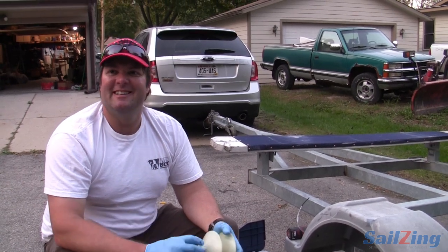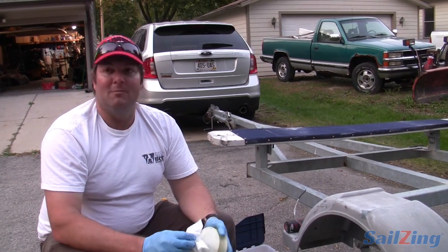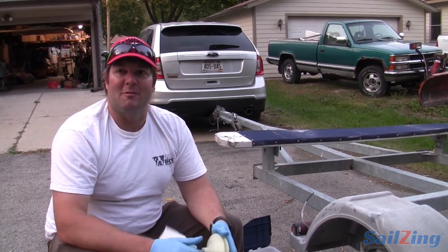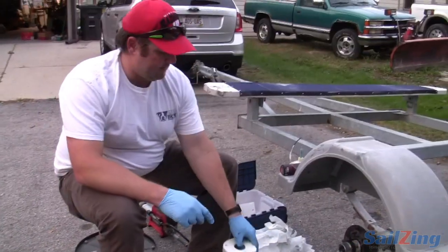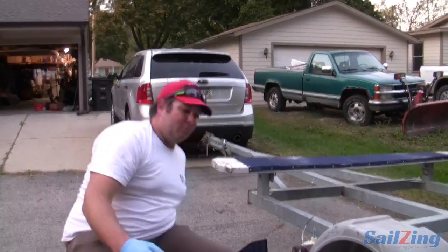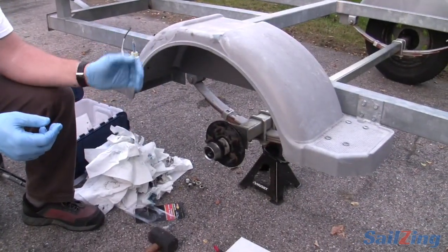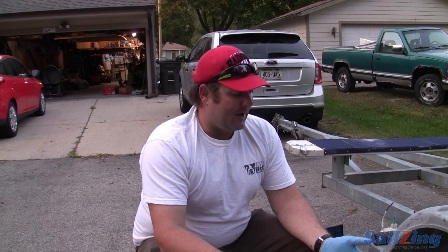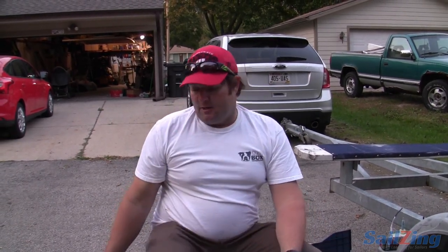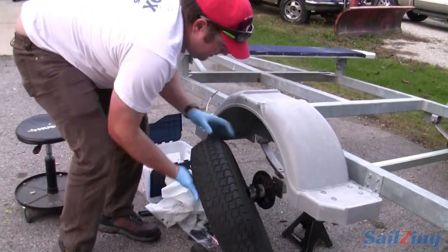Final disclaimer: I am not an auto mechanic. This is all stuff I've learned from my experience and from smart people around me, but I don't claim this is endorsed in any way as the absolute correct way to do things. Every video I've seen really didn't go through all of these steps and how to look at things — that's why I felt it was appropriate to do this video and talk through the steps, including the cheats like buying that pre-greased hub. If you've done your bearings at home, you know how easy it is to come apart: pull the pin, slide a new hub on, and you're back on the road.